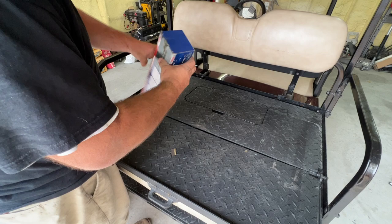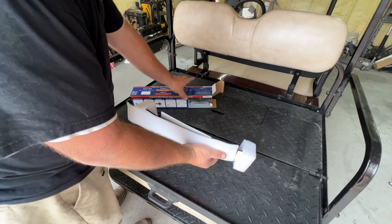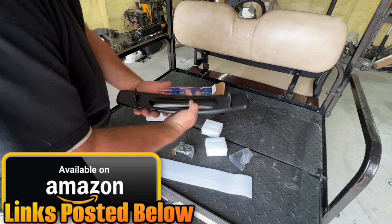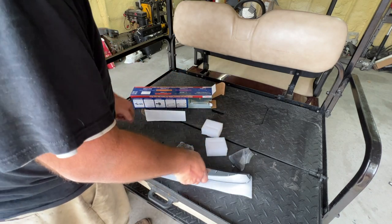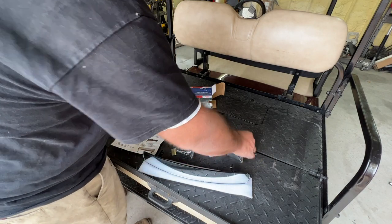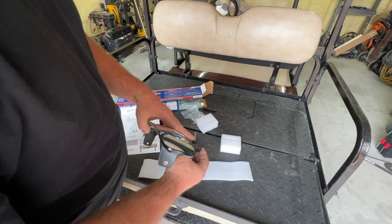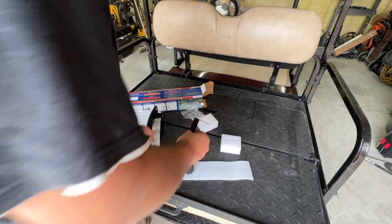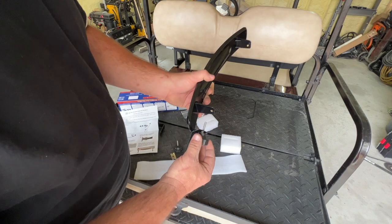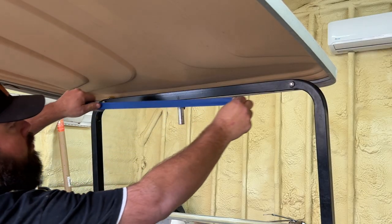Let's take this mirror out here. This is the mirror itself — it mounts on both sides with a large wide mounting bracket. When installing these mirrors, note that these threads are left-hand threads. Put it through the bracket, and when you go to set it on you screw it to the left — so lefty-tighty, righty-loosey on this one.